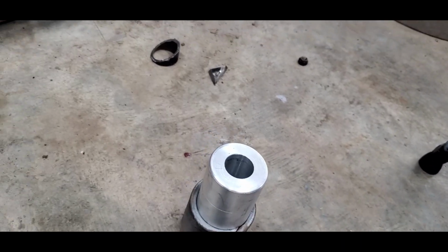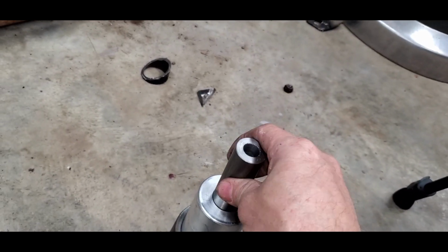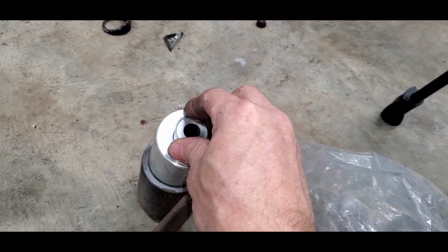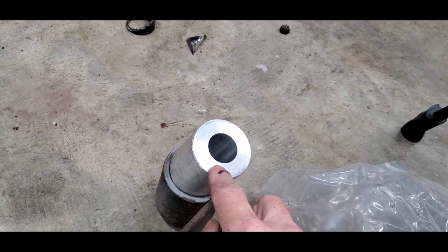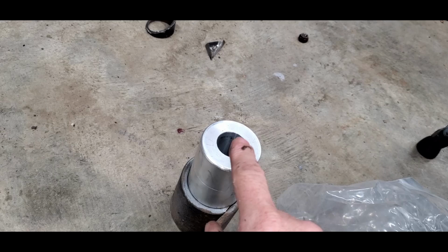It needs to be the correct size, because you have this steel sleeve that goes in there. This has to go inside there. And of course, this has to pivot with little to no play. So if you hit this directly, it'll mushroom this little end here, and it won't be hard to do because this is made of aluminum.